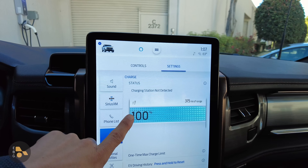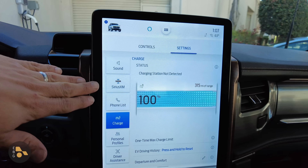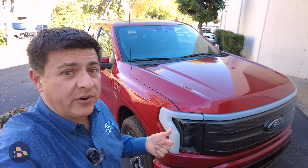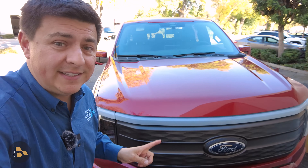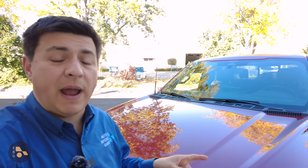You can also decide how much power you want the vehicle to offboard — whether you want it to drain the battery completely or leave some reserve — and you can tie that with the charging settings to decide how much you charge and where. If you want to make the most use of this function, you'll probably want the battery pretty fully charged most of the time. Keep in mind that if you roll in home on a Friday afternoon with only 20 or 30 percent battery, that's all you'll have. But the Lightning's battery is 131 kilowatt hours, which is quite large even for an off-grid setup. I live off-grid and this has usable capacity about 30 percent larger than my off-grid storage array — I'd probably survive about two days, depending on usage and conservation.